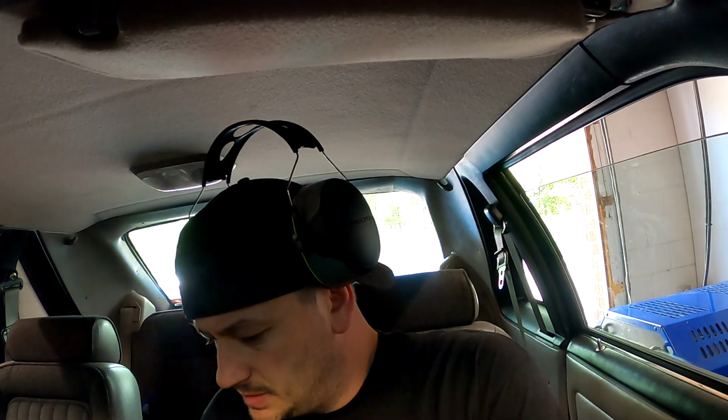Picked up like 5. Nothing's easy. Alright, I'm gonna yank a plug out and I'm just gonna try a couple more degrees, see what that does, and then I don't know, maybe depending on what that does, I'll back the timing off in the ECU and maybe try and mechanically advance it a couple degrees. This isn't how this normally goes.